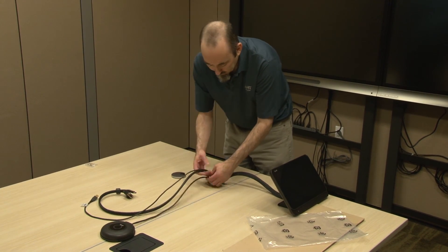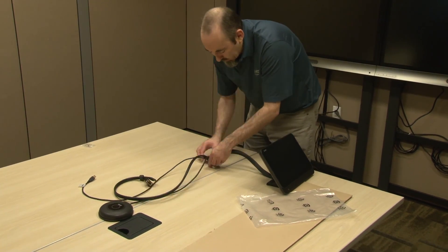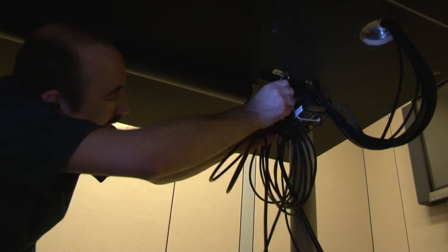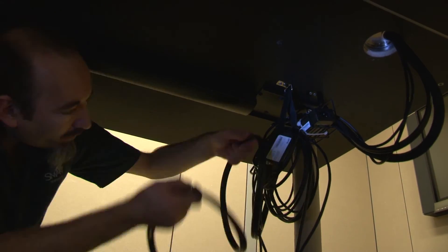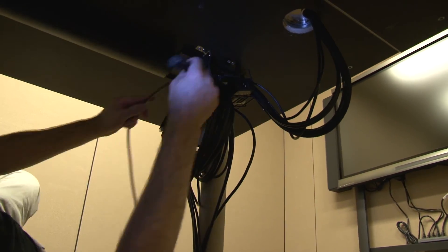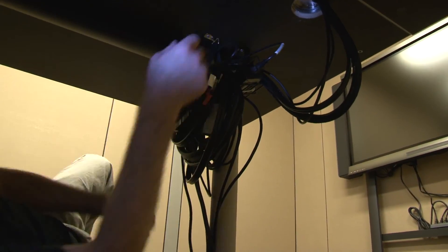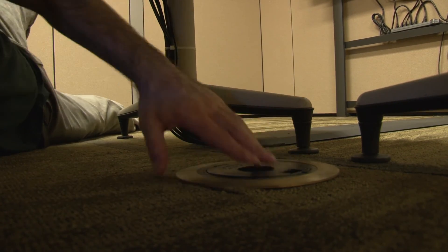With all cables and components in their desired location on the meeting room table, attach the grommet cover if used. Secure the console power supply into the provided wire basket using nylon ties and use the provided Velcro straps to help manage cables beneath the meeting room table. Be sure to leave a slack loop to allow cables to be moved through the table grommet as needed during normal system use. Also, be sure to connect the guest computer's HDMI and VGA cables and the guest computer's USB cable to their extensions under the meeting room table. You can also use nylon ties where needed to keep the installation tidy, and don't forget to provide power to the console's power adapter.